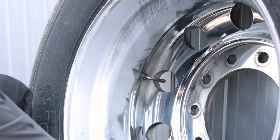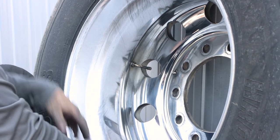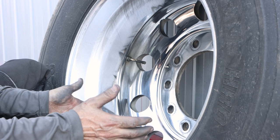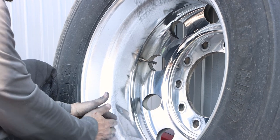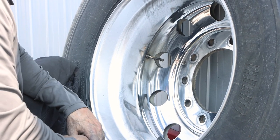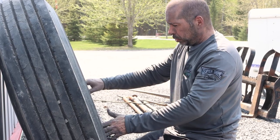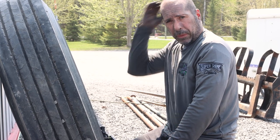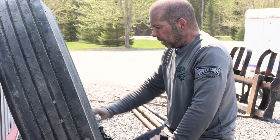For the outer part I'll use the 6,000 RPM. When the rims are still on the truck, I do the whole rim without moving, but because this rim is loose, I do my sweet spot — the easiest part of the rim to polish — then roll the wheel, do that section again, and repeat until it's done. If it's on the truck, you can always jack it up and spin the wheel, which makes it easier. Let's get started.